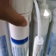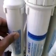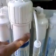All the arrows on your filters should be facing up except for your reverse osmosis filter, which has an arrow that should be pointing down. This machine apparently doesn't have any arrows on the filters, but originally your machine filters should have arrows on all of them — all pointing up except for the reverse osmosis, which points down.